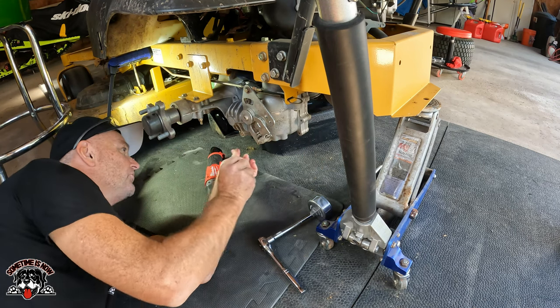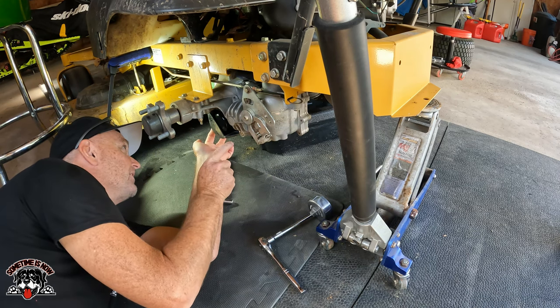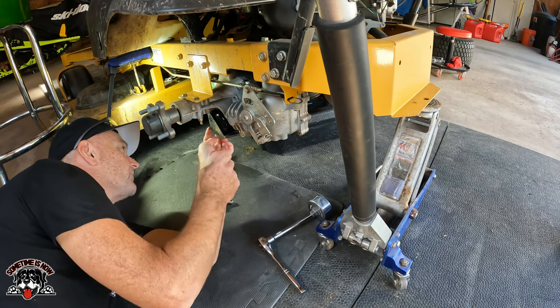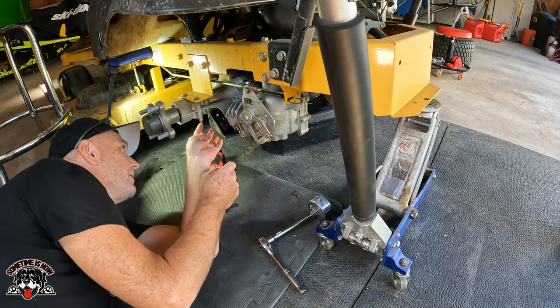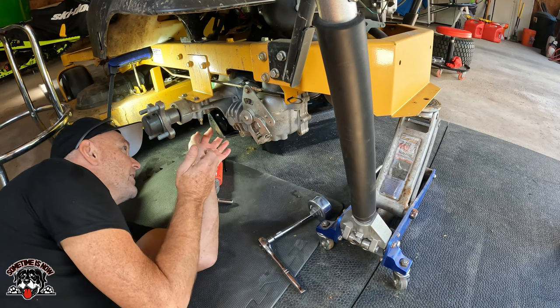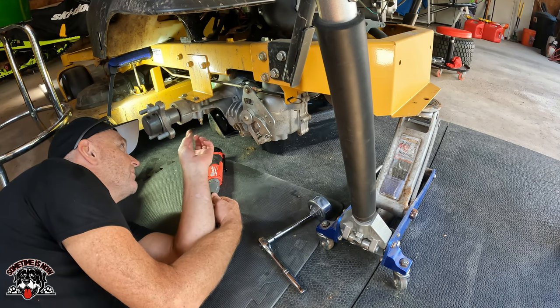And there's 2 hoses that come off the bottom of the reservoir that fills both of these simultaneously. So if you fill that reservoir and you don't take the bleed screws out of the top, the vent plugs, you're not going to get any oil to drain into your transmissions. So we'll have to take those vent plugs out.